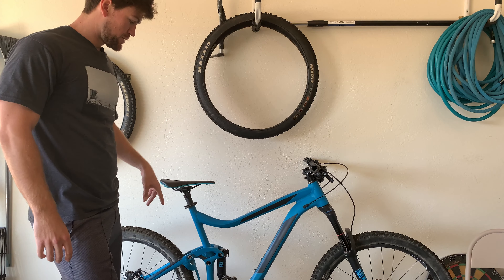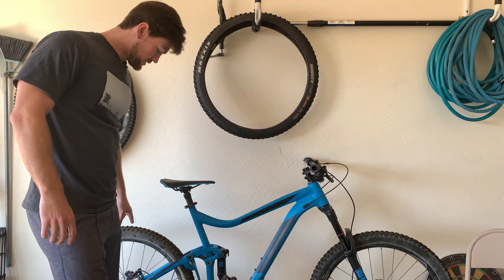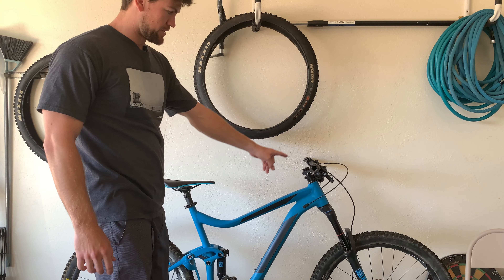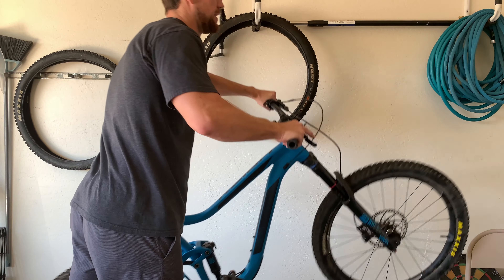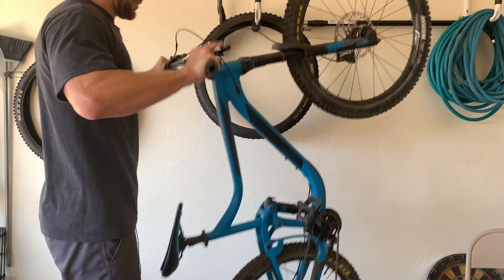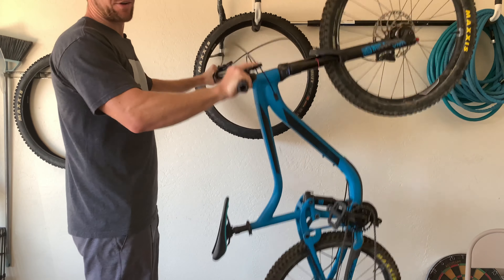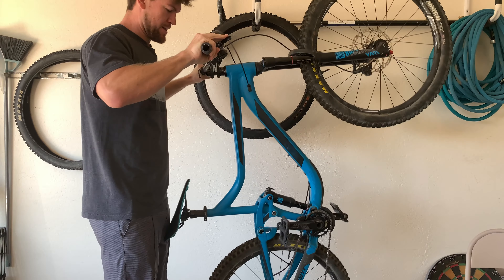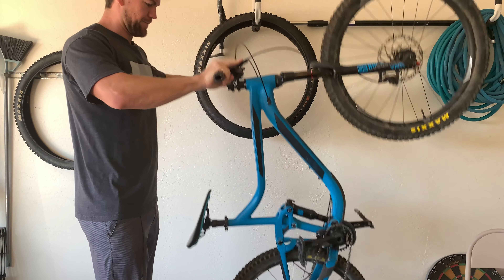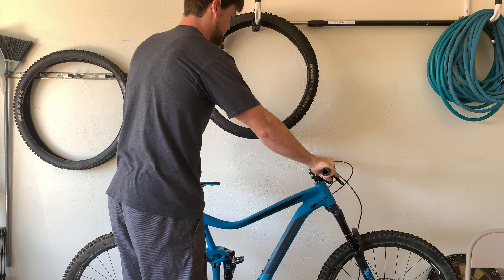I'm doing the rear brake. First thing you want to do is get the bubbles to the top, up near the actual brake. There are going to be bubbles in the line because it's not solid fluid all the way through. So to start, give the bike a little bounce — just get all the bubbles moving to the top via gravity and physics.